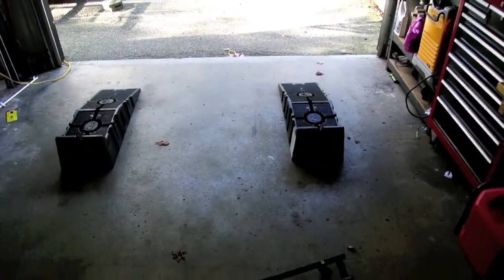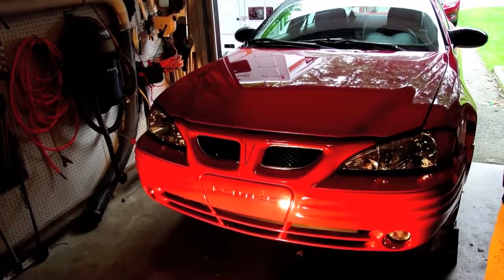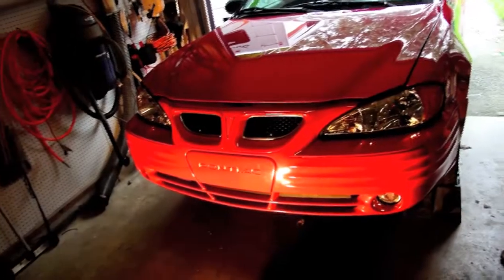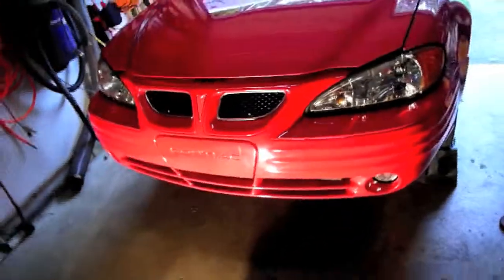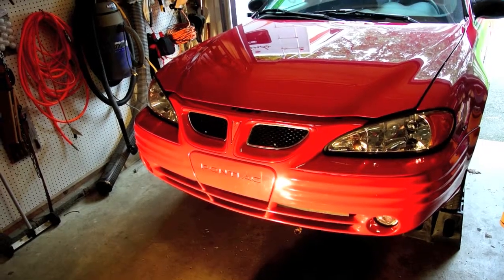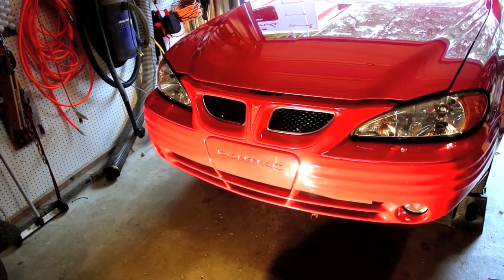We got the car ready to come into the garage. I've got a couple small ramps and we're going to start pretty soon. We're going to install it today. One of the things I have to do - I've read through the instructions three or four times. Since this same tow bar is used on several different model GM cars, I'm going to have to kind of verify things as I go. Where the lower dam is, there's the lower vent - just enough room for this to fit in here. The instructions say to bolt the base plate on, then put the front grill back on temporarily and adjust the base plate up and down before drilling so you make sure to get the attachment centered.